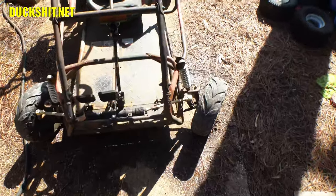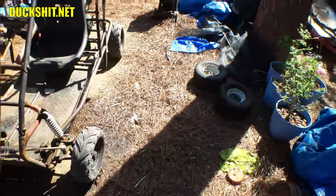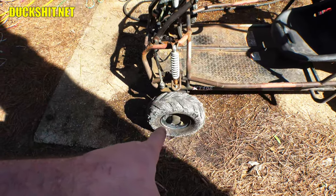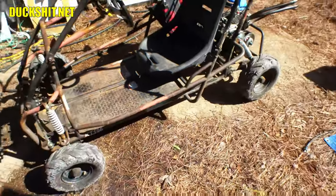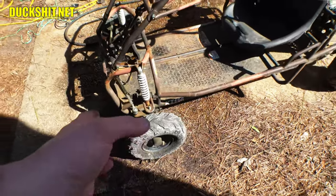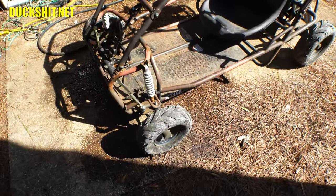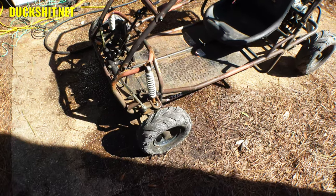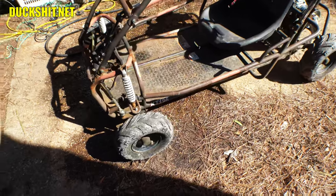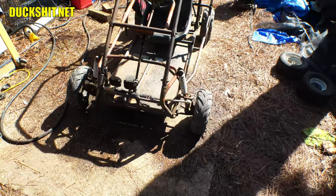So what we're going to do is a little correction here. I'll show how this is modified to make it correct. It involves a little bit of geometry — we have to measure from the top of that spindle back to the rear axle. That ball joint on top happens to be in line with the spindle, so we can actually measure just the wheelbase. We can't do that in every vehicle because these have no caster. That arm is completely in line, perfectly straight — that's another improper observance of steering geometry. Caster is very important to make this thing drive straight, and well, it has none. Anyway, we're going to do a little modification here and take some measurements.